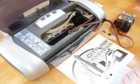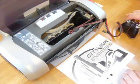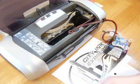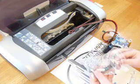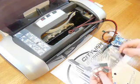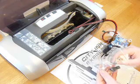like so. So one of the next things to do on the continuous ink system is to install the air filters. So remove the air filters from the bag. Any other bits and bobs that you see in the bag, they're all spares. So just put them back in the box.